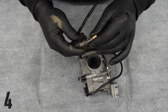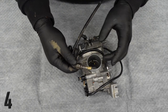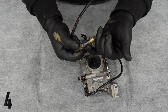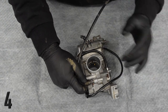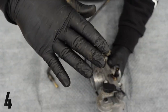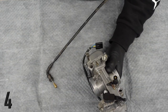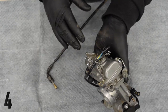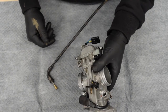It's not going to feed your carburetor weird things. This does have an O-ring on it, and when we go to replace this and put it back in, I will be replacing that O-ring again just to ensure this isn't trying to mess with any jetting whatsoever. But if it seems like you've got a ton of lean conditions — a hanging idle, it's not happy, it's popping, it's backfiring on decel — and you're like, man, I just got my pilot jet all sorted out, what the heck could be going on? Check that. That's a good place to start.